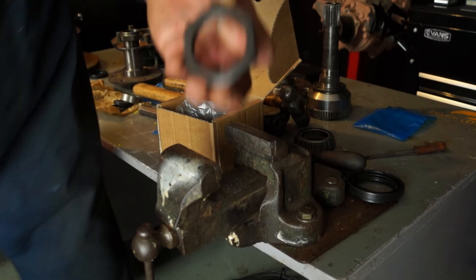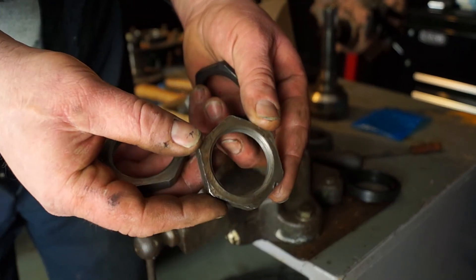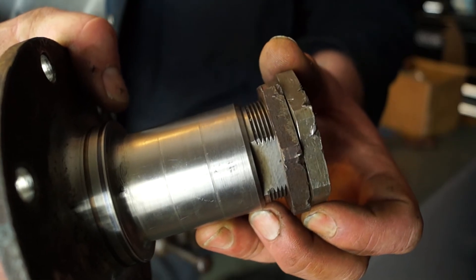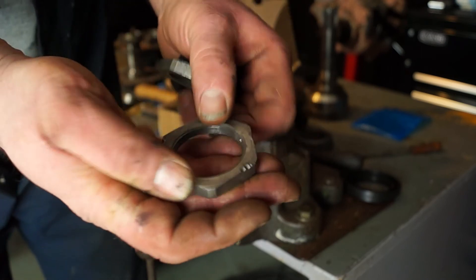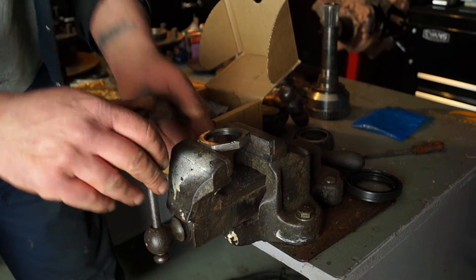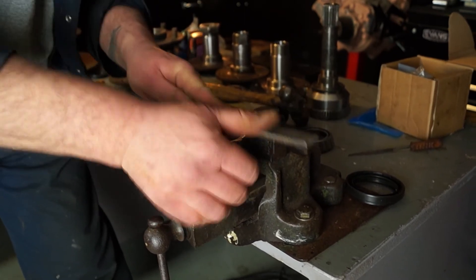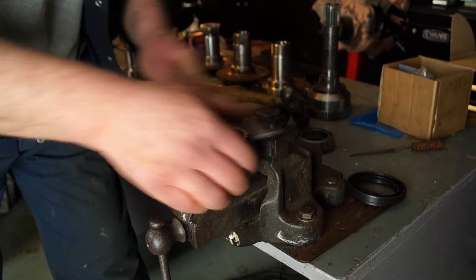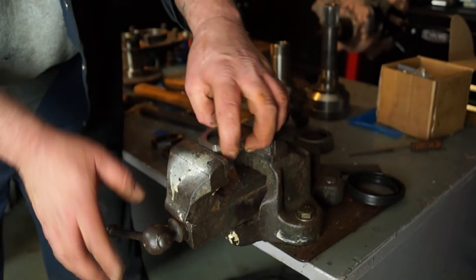The last thing — in a wheel bearing set that you'll get, you'll have a hub nut. One brand new nut. Usually what you find is screwed up and chiselled nuts. I haven't seen one that's in good condition. I don't know why people chisel them. These are not acceptable to fit on. If you screw these and try to tighten them up and you have burrs on the faces, they won't lock properly. So what we're going to do — you can see the raised parts here, and this is on all of these nuts — is put it in the vice nice and flat and then file it so we're taking off all the excess and damaged material on the faces. You get your file nice and even and you get a flat face. I'm sure you must have done this in metalwork at school. If not, then it's time to learn. At the end of it, what you're looking for is smooth faces so it will mate properly. If not, keep going until they are. Just don't misshape the nuts.